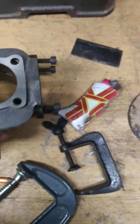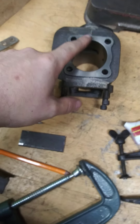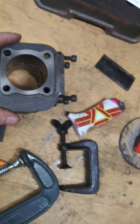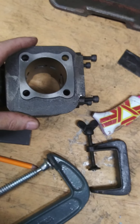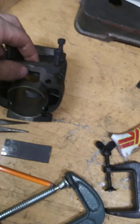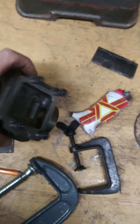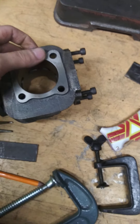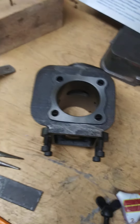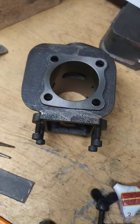I kinda wouldn't have put the intake here at the top. I would've made it so you never have intake coming directly in from the exhaust side while exhaust is going on — kinda turning this into a case reed setup. Like, block this hole off and put the opening further down, make that channel a little different. You'd never have any intake overlap that way. But it's all speculation, all theory. Like I said in another video, there ain't no factual information to be had here, so don't go telling your family or your boss — you'd probably get laughed at.